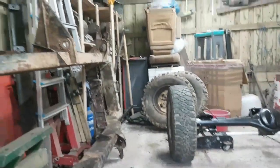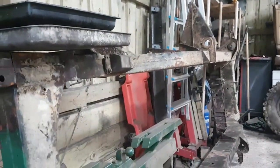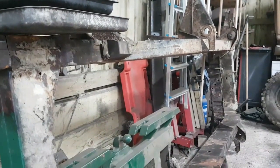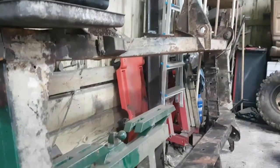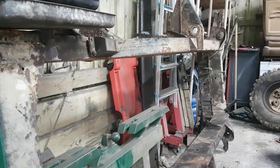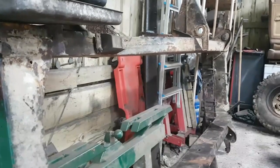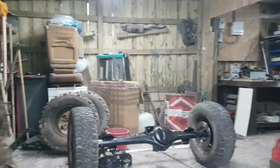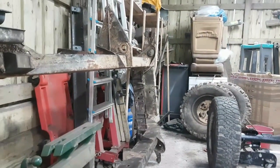I mean, I can start welding on the bulkhead and the side frames, because what I'll do is I'll fit it onto the chassis first of all, work out what needs to go where, take it off to cut it, put it back on again to line things up, just use tag welds just to hold things in place, take the bulkhead off to seam weld it, because I really don't want to be damaging the paintwork on the chassis, because it will be completed. And I know it's a lot of putting on and taking off, but sometimes you really don't want to be using grinder sparks right in the back end of your workshop. So by fitting the bulkhead up, working out what needs to happen to it, and then taking it off again, it's going to make life a little bit easier.